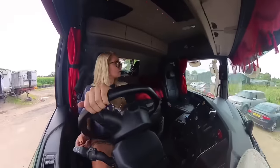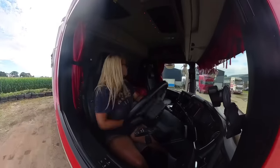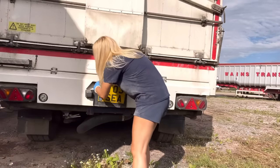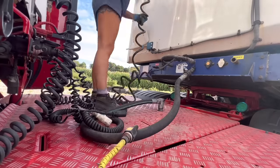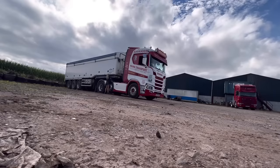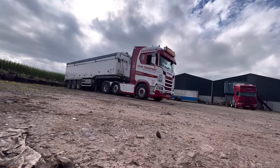I won't need the blower trailer for the work I have for tomorrow, so I find a space up the yard in the trailer line-up. I'm quite glad that's over because it's not the best job in the world to do. However, today hasn't been as bad as I thought it was going to be. I take my number plate off, I wind down my legs, I unplug all my Susies and unscrew my hydraulic pipe. And then remove the clip and pull the kingpin. Then I pull forwards a little bit, drop the air on the back, and then I can pull away.